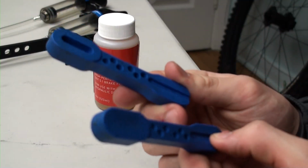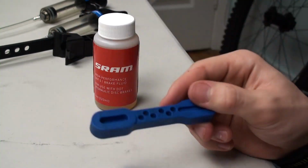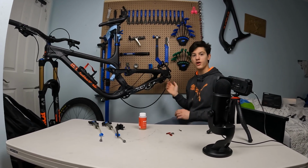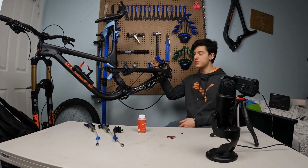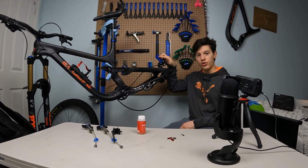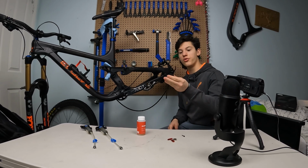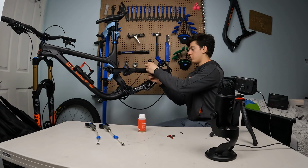As it is a 4-piston brake, you're gonna use 2 of those little blue things. So now you put those 2 little blue things inside the brake, on the pistons, with the 12mm spacer, not the 10 that is written on here, but the 12. So now you can install this strap right here, and I'm gonna install it right here on the bottom.